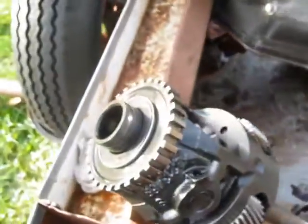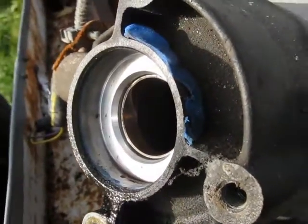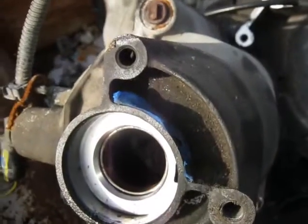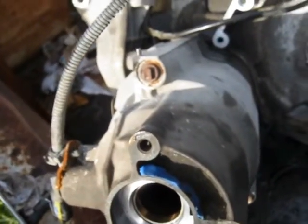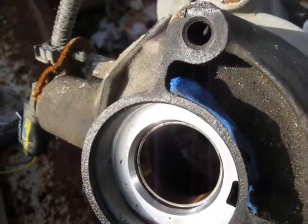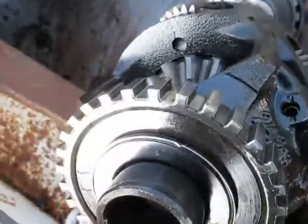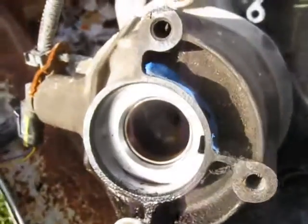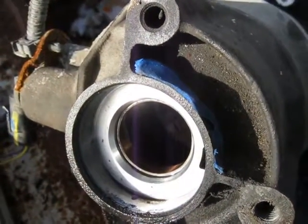In my humble opinion, that bearing is not long enough in this direction. Consequently, that's why it decides to wear out and get loose. I'm going to measure it and the shaft to see just how loose it is — it's loose enough that it causes problems. To replace it, a person would basically have to gut the transmission as far as I can tell. You can't get in to hook it because this thing's in the way. In all fairness, it did last pushing 200,000 miles.